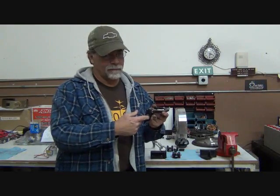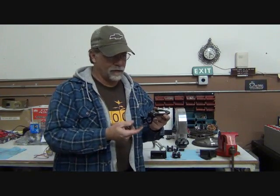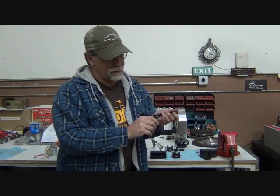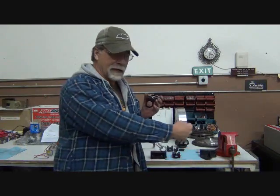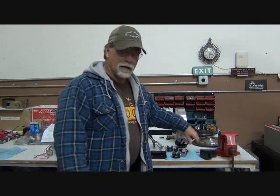Also on the front end here, we can't go that way because we run out of tunnel, and there's that end on it, and I'll show you a photo of that, that there's a cup, there's a ball on the bottom of the shift lever that fits in. Well, that's larger. That will not come through this. So going that direction towards the back isn't an option. We have to go out towards the front. Well, towards the front, we've got to come through the car. So Volkswagen has accommodated that. There's 3 cover plates that must be removed in order to remove that shift rod.